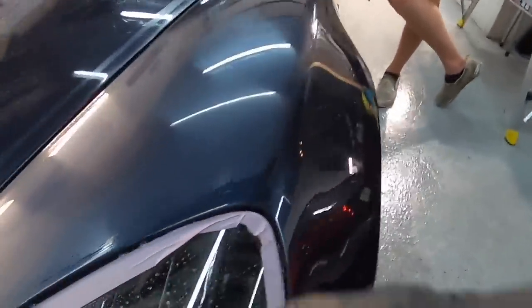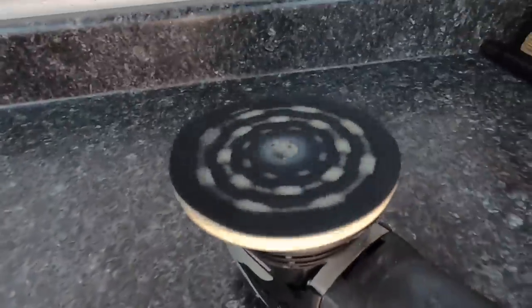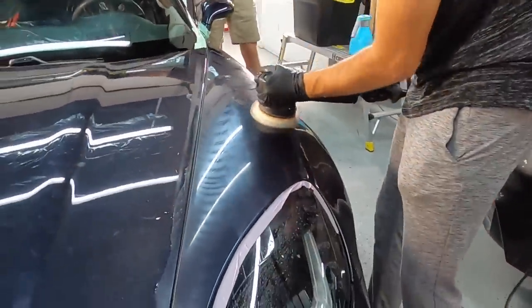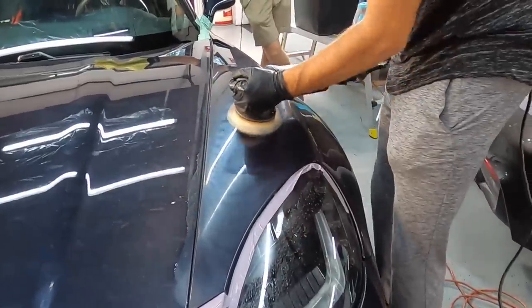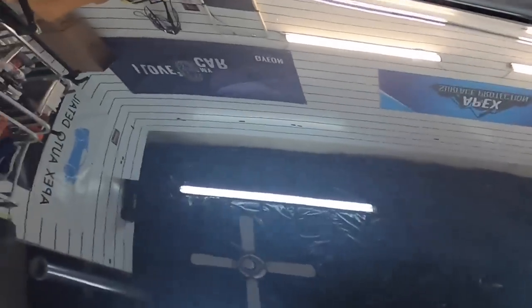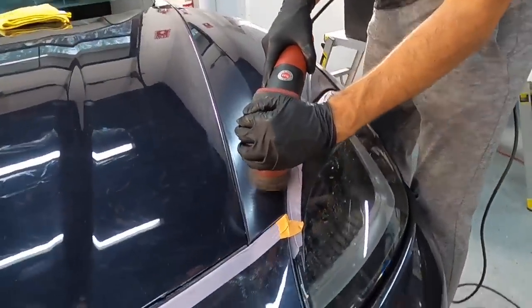Let me bring you in close so you can see the work after the first two steps. The oxidation has been removed and clarity is slowly starting to come back. All we need to do is polish out what we've exposed — some nice fresh clean clear coat. We'll use a one-step here on this particular hard stubborn clear coat: 3D One, a fiber pad, and a polisher with a 15mm throw. The oxidation is gone, the sand marks have been removed. All we need to do is refine it further, work the edges, and if needed bring in a finish polish or cleaner polish. It's completely up to you how far down the rabbit hole you want to chase imperfections. To work the edges, simply bring in smaller and smaller polishers.